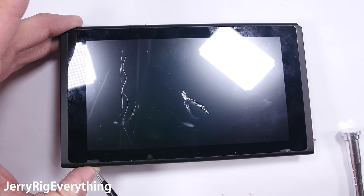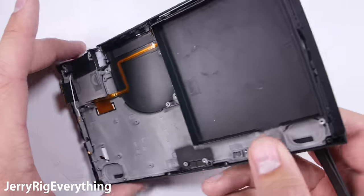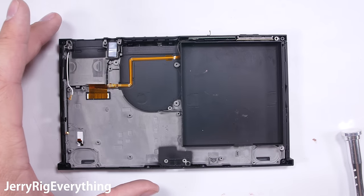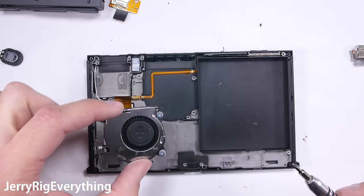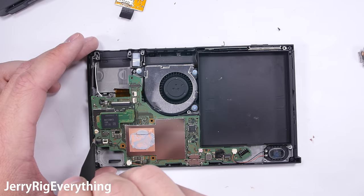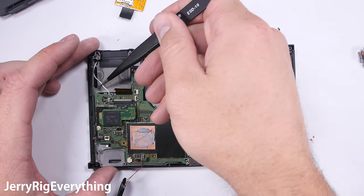The super long ribbon cable at the top is for the volume and power buttons. The exterior plastic layer and the LCD layer are not glued to each other like on most cell phones — they are actually independent components like on an iPad, but they are glued to the console itself. Replacement screens are hard to find for Nintendo products historically. You'll need heat to separate the screen from the frame, and the new screen will have its own adhesive.